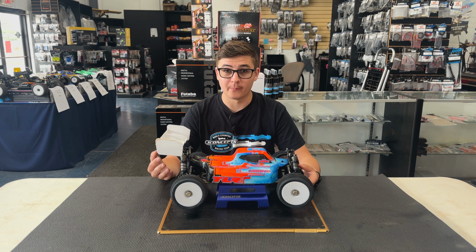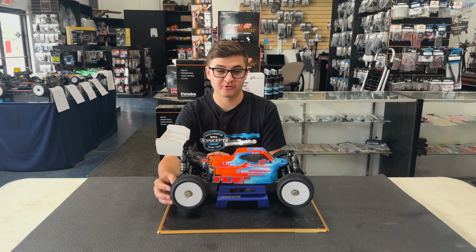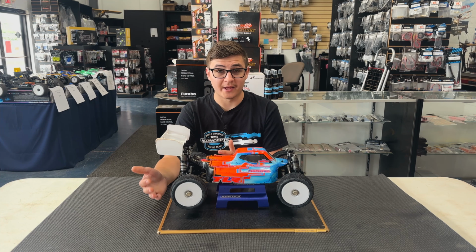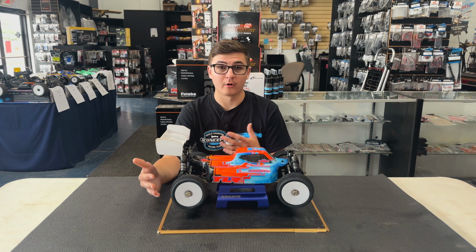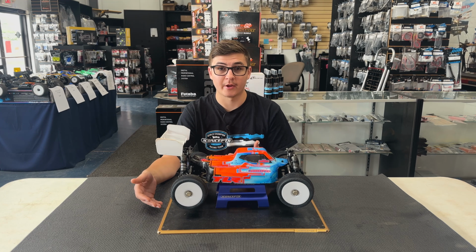You're going to get more stability out of the turn. The rear wheels are going to work more together as you go to the thicker fluid, so it's going to stabilize the car a little bit more. Hence, again, why it's better on that more big open track. Whereas you get more of that off-power rotation as you go to the thinner fluid, again, better on the tighter tracks.